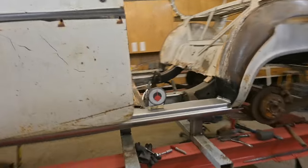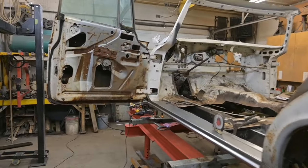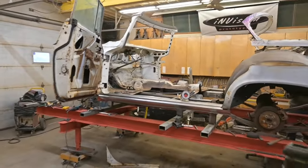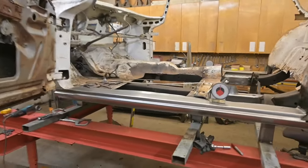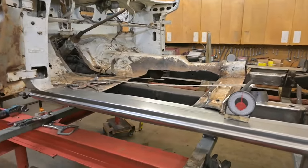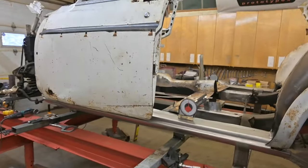And there we go, guys. Inner and outer rockers installed on screws and door mounted. I hope you guys enjoyed this episode. It was a lot of fun. Cutting, and more cutting. But you can see why we did all that cutting. It's a lot easier to start from fresh and splice into existing good material than trying to scab stuff onto rust. Because at the end of the day, when we close these doors, they're going to click shut. You won't need to slam them.